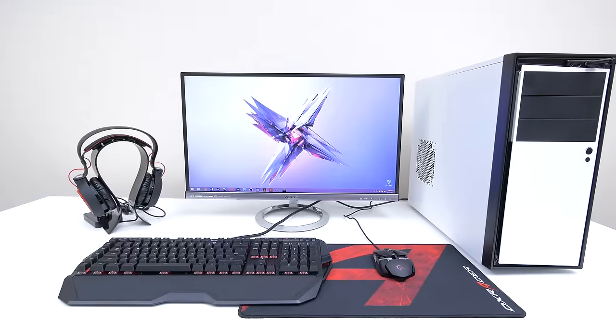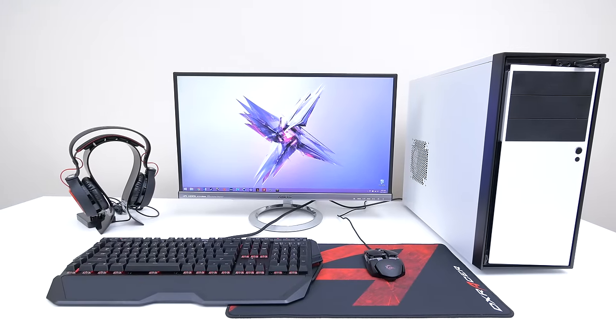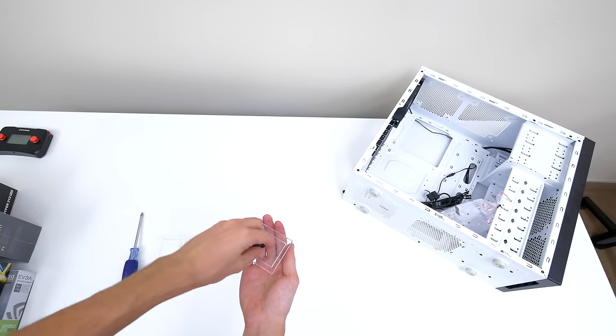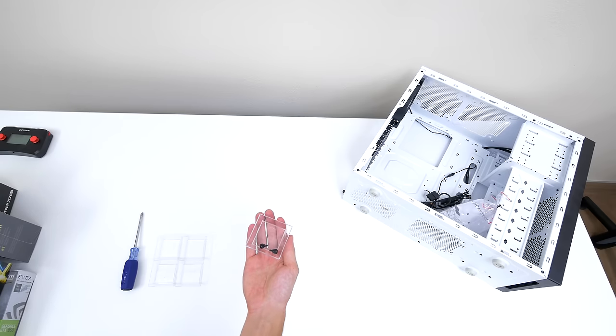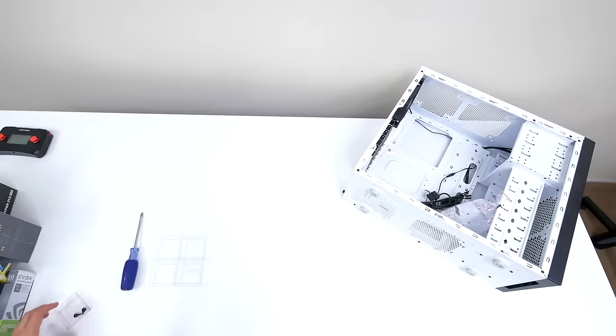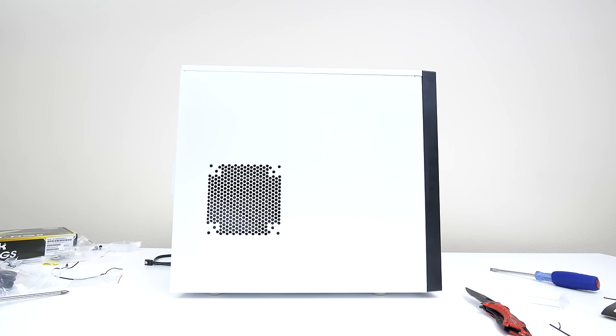So in this video, I will show you step by step how to build yourself a badass PC with a fresh installation of Windows. All you're going to need for this build is a screwdriver, and I recommend picking up some Petri dishes to help you organize your screws so you don't lose them. I'll link a few options down below for you. One thing to keep in mind when building your PC is to constantly touch the metal part of your case so you can ground yourself and not build up static, which can potentially damage the parts.